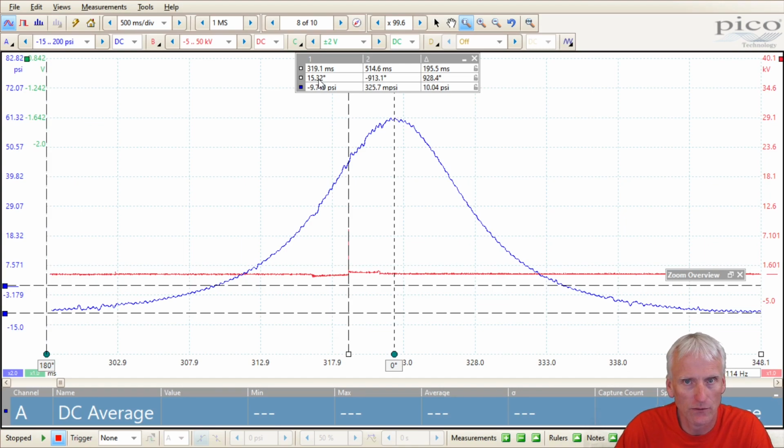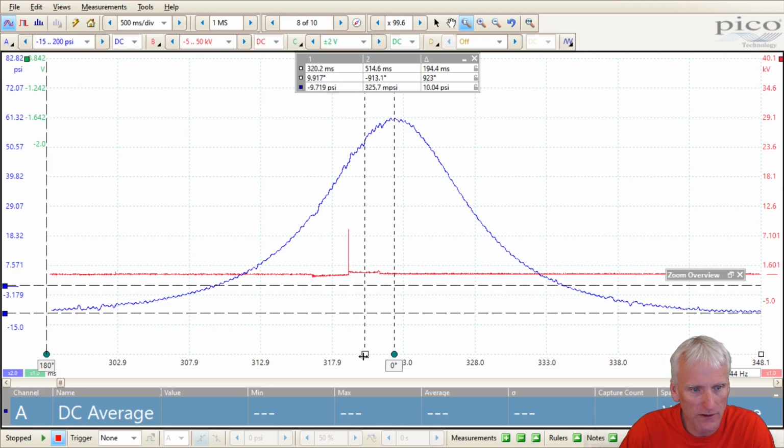degrees. Now if you remember from the scan tool images that we were getting, it was pretty much averaging between 8, 9, maybe 10 degrees of advance. So it looks like it's about 5 degrees delayed. And so in reality, the spark, according to the pressure waveform, probably would have occurred right around this area.